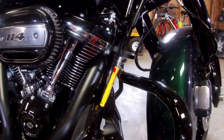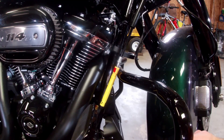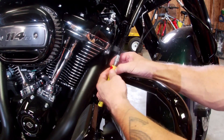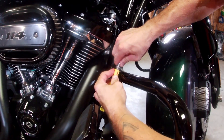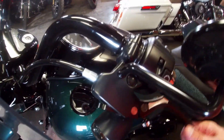Of course, if you're going to loosen the cable to change out a lever or make an adjustment directly to the clutch, you need to pop out the red tab, then squeeze these two parts together to compress the spring, press that tab back in, and that leaves you with lots of clutch free play.